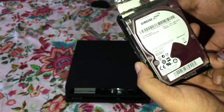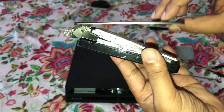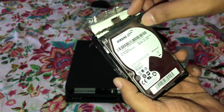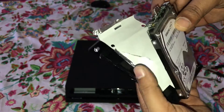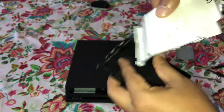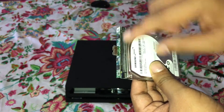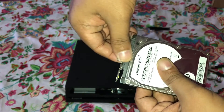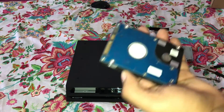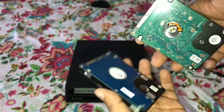You just need to pry open the hard disk case. It won't be really easy — you have to apply a little bit of force to pry the box open. Be careful not to scratch the hard disk itself. It will be covered in aluminum foil, so just remove that. Then you'll have a connector on top — you can just pull that off. And it's basically the same hard disk; it has the same pins and the same size.